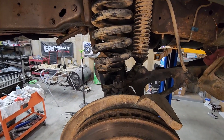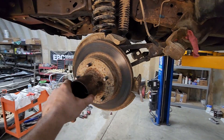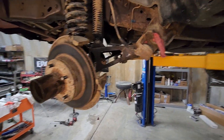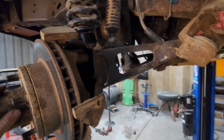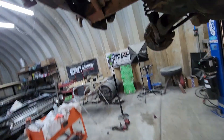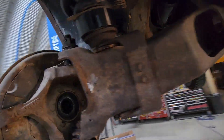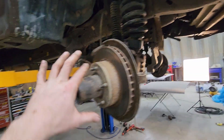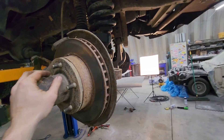Look at the top ball joint — that is 90 degrees. This thing has zero caster laid in it because of the radius arm. So if you're wondering what radius arms are going to do, you can see the angle definitely in the bushing — see how it's tilted? We are going to fix that by building radius arms and tilting this axle out from under itself.